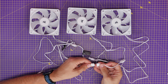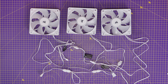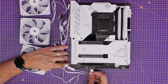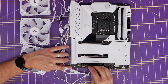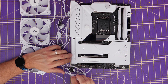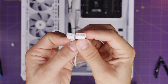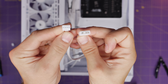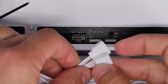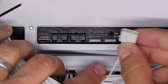In terms of the fan cabling, these additional RS120 fans are straightforward — they daisy-chain from one fan to the next, and then you need to plug them into the 5-volt RGB header and chassis fan headers on your motherboard, allowing you to connect three fans per set of connectors. This obviously relies on having those connections on your motherboard. You'll likely have chassis fan connections, but you might not have many 5-volt RGB connectors, so that's something to bear in mind when buying this case with these fans.